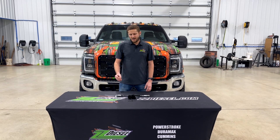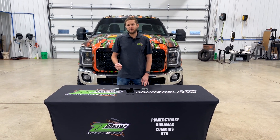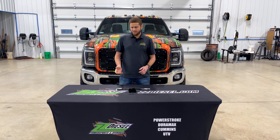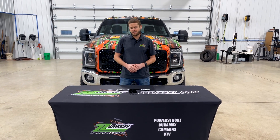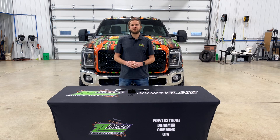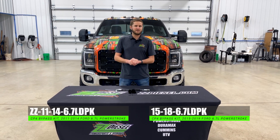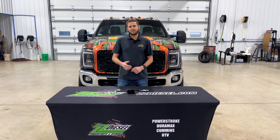This entire product is designed so that you only have to replace the CP4 pump on your truck if there is a failure, rather than replacing the entire fuel system including injectors, rails, sensors — all of that you see in our complete contamination kits. The purpose of this product is just to deadhead that and contain it right at the CP4 pump itself. That way if there's a failure, you remove the CP4, you replace it, and get your truck back on the road.